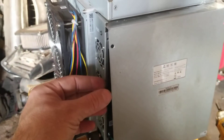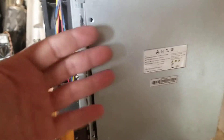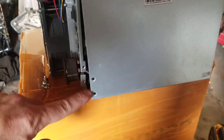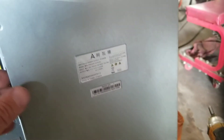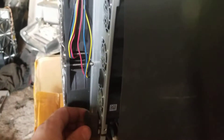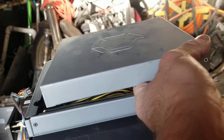So we're replacing it with a brand new power supply that they sent. To start out, we took off the cover, which is real simple — you've got a few screws here, here, here, here, and here, and then this cover part just pops right off. You don't necessarily need to take that off, but we had to in order to see what happened. What happened was there was a fuse down there that was cracked somehow, and that's why it wasn't working.